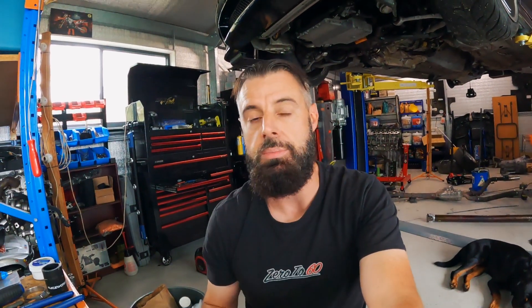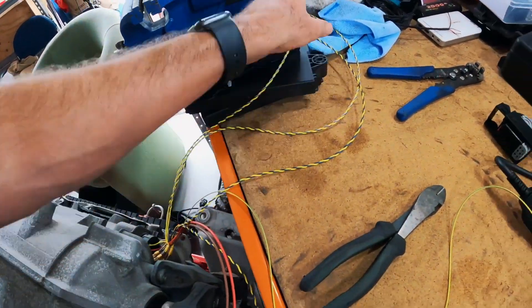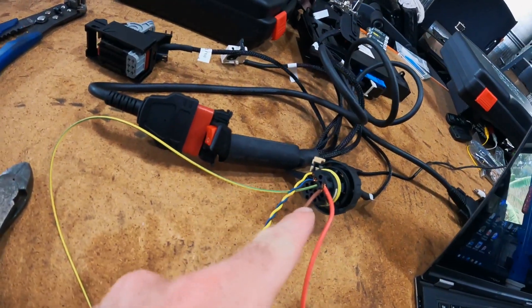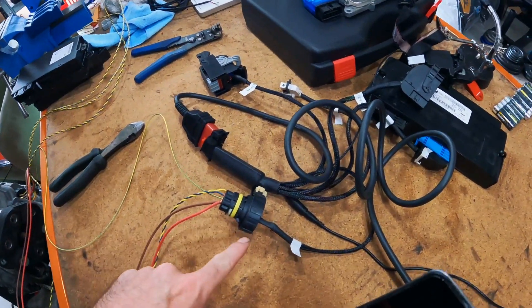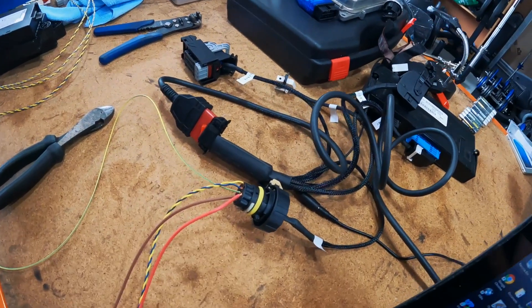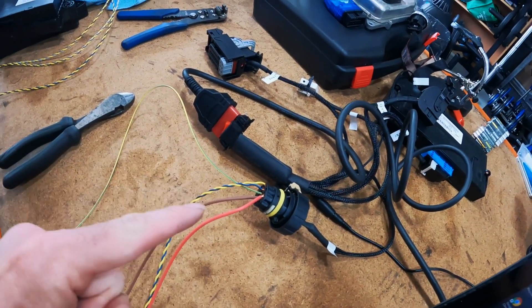What I want to try and do today is at least see if we can communicate with the box only on the PT-CAN, and then maybe try and flash it as an E84. All I've done is taken apart the F-series plug - these are the CAN bus wires that don't get used. This is the bench top harness that I use for doing E-series DMEs and CASs. It happens to have a ZF6 or 6HP connector on it, so I've just connected the PT-CAN, the wake-up signal, and the main power.